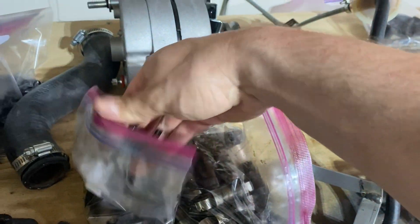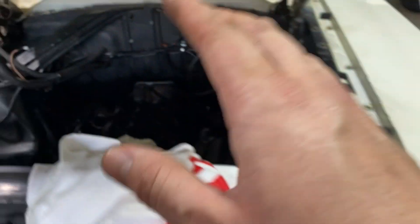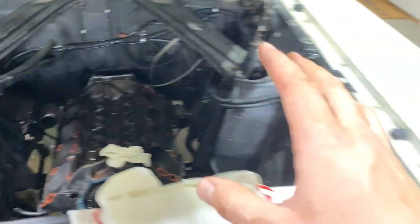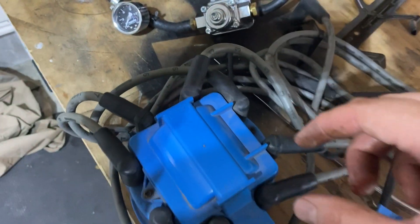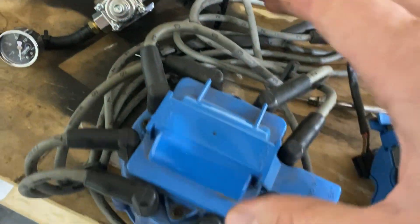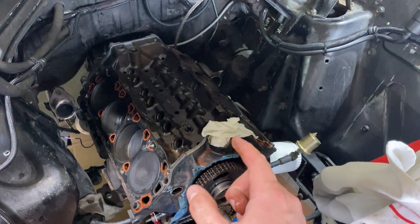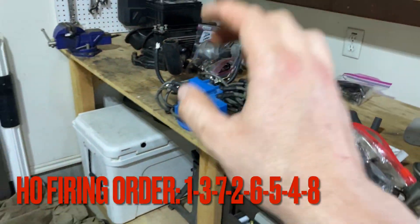This is pretty common. What this means is I do have a hydraulic roller motor, which means it has a hydraulic roller cam, which also means you have to make sure you get the correct drive gear for your distributor. This specific motor is a non-HO, meaning the firing order is the older style 302, not the HO firing order that a lot of people are familiar with. What I'm going to do is put an HO cam in here - all you need to do is change the firing order for the plugs and you can turn this into an HO motor.